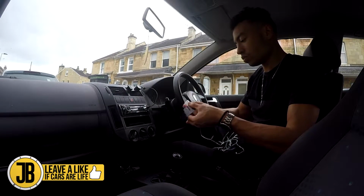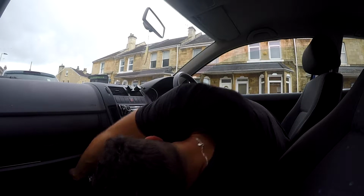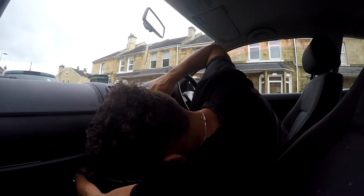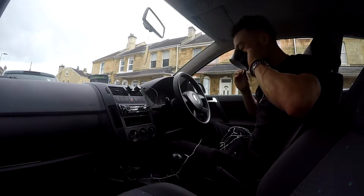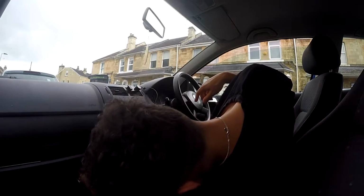To start with, firmly attach the battery box to the passenger footwell using the duct tape. This is only a temporary solution until I wrap this part of the car. Obviously, by duct taping this part of the battery box, you can't replace the batteries easily in the long run, so if you're not planning on wrapping this part of the car later, just get some double-sided tape to stick it to the same place.